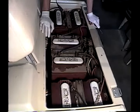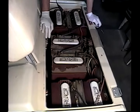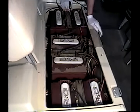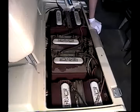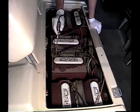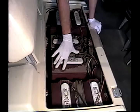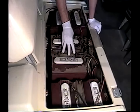This is a 48-volt Club Car. One of the easiest ways to identify it is the charge receptacle is round as opposed to the V-shape. Another easy way to identify it is the posts on any given battery are on the same side of the battery rather than alternating. That means these are 8-volt batteries rather than 6-volt batteries.